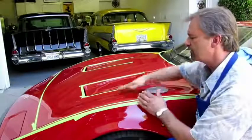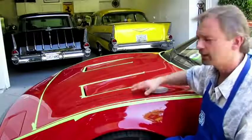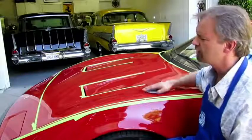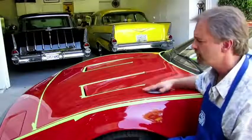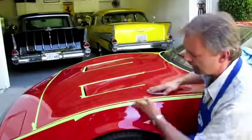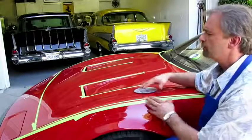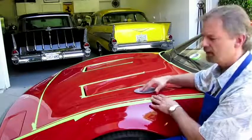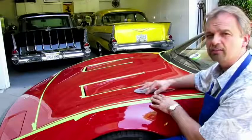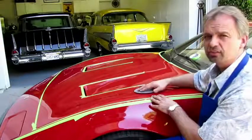There's a big difference in color from this side to this side because of the oxidation that's happened on the top surface — not because this car has been mistreated, but because it's seen a lot more UV light than the sides have. You can actually see a difference. What we want to do — and we are going to color sand the sides — is enhance and bring up the richness of the original color by getting down into the fresh paint underneath the oxidation.